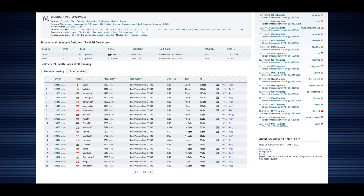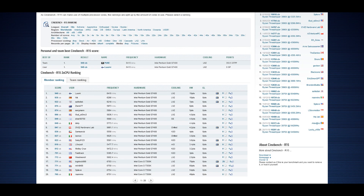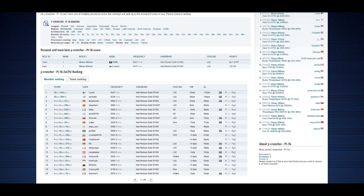That's roughly 52 points over the previous rank one by safedisk from South Korea, which was extremely difficult because the G7400 is so memory-limited. Many G7400 CPUs have very bad IMC — this one can only do up to about 7,000MHz on memory and doesn't scale much even with command rate 2 or LN2 on the memory. I stuck to 27-37-37 command rate 1 timings for the whole session, with memory frequency between 6,500 and 7,000MHz. High BCLK with strong memory allowed me to reach the new rank one in Geekbench 3, R15, and R11.5.